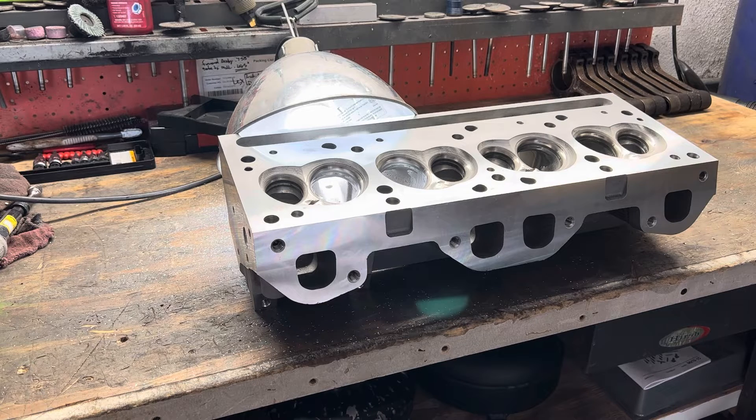You don't want to do that. Basically what I'm trying to do, for lack of a better term, is kind of bevel just that one side of the intake port so that there's a smoother transition between the port wall and the valve seat itself. It isn't optimal, but I would rather have a concentric opening.